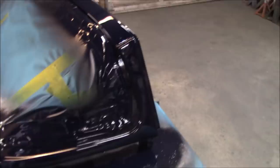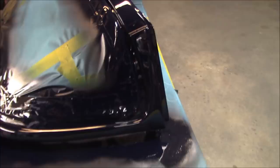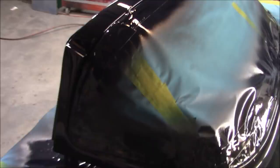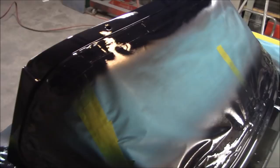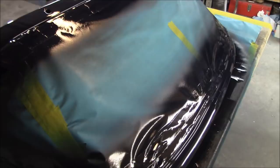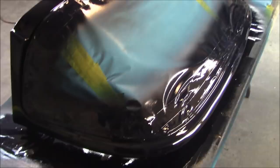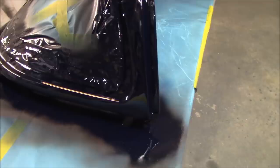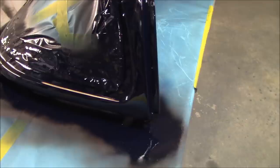7 pm update — so far so good. We've got three coats of clear on it now and it's looking really good, no runs. We're not past the critical point yet — it's not quite dry enough that I'm not worried. I want to unmask it within the next hour or so, and that's also going to be a test to see how that tape did. I don't want to leave it too long and risk ripping the paint. Wish me luck when we get to that stage, but for now it's looking pretty darn good. We'll come back for one more shot when it's unmasked.